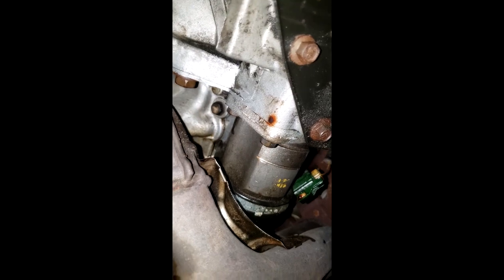Also, because that's originally supposed to be a sealed connector — imagine if it was sealed to the point where it wouldn't be able to vent. I should have been saying vent instead of breathe. This connector needs to be able to vent in the event that sending unit fails. I just started pulling that tab on every last one. I got a short video on that doing very well, but I got to replace that oil sending unit.